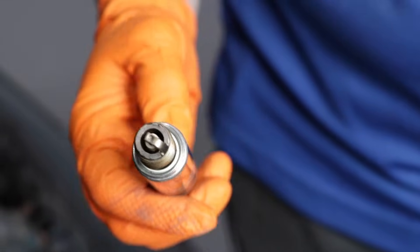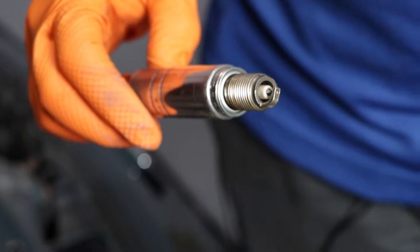We can see the spark plug from cylinder five is nice and clean — it's not misfiring. So let's see what happens after we swap it. I'm going to take my scanner and clear the P0303 code, because I took a good known cylinder's spark plug and ignition coil and swapped it back and forth. Then I'm going to run it — the engine's still going to shake because hopefully it's a bad coil or spark plug, which is an easy fix. We'll still have a misfire, but hopefully it will swap right over to cylinder five. Let's give it a shot.